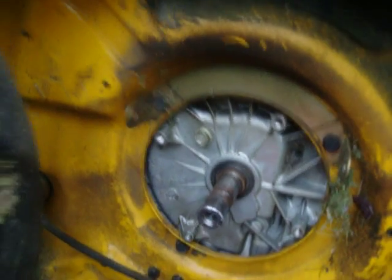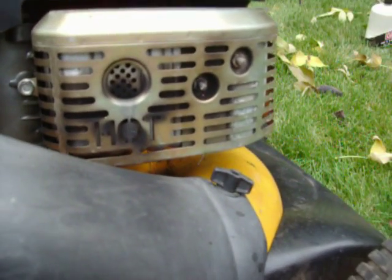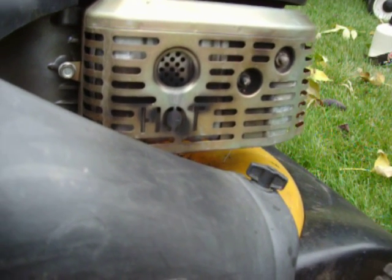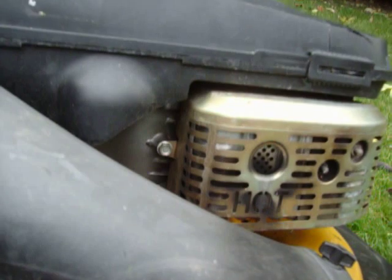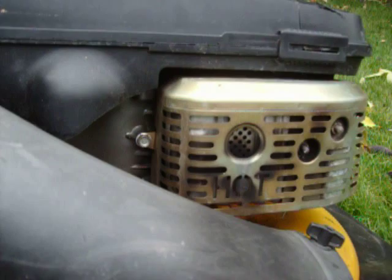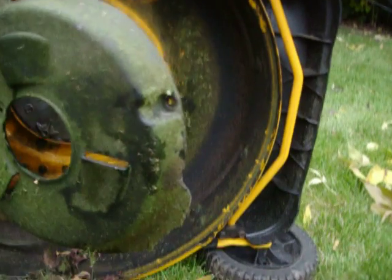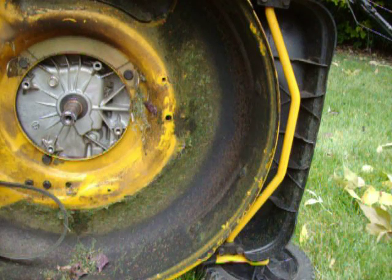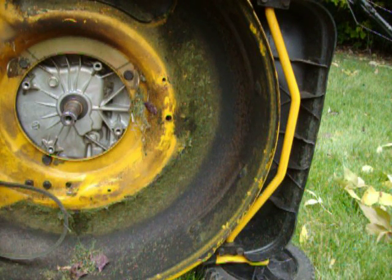On all lawn mowers, of course there's a carb. Here I'm going to tip this back over. You want to make sure where your carb is — my carb is on the other side because here's the exhaust. On some lawn mowers, the exhaust and carb are on the same side — that's on the cheaper lawn mowers most of the time. You'll want to make sure that your carb is pointing upwards so you don't flood your engine. But in this case I'm changing the oil, so I want the drain plug as high as I can get it, because this engine is set up a certain way.